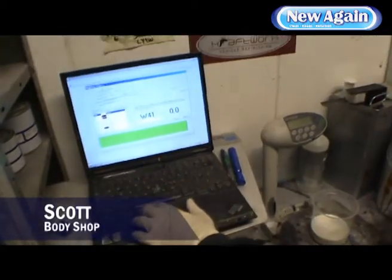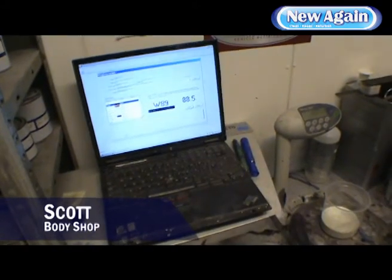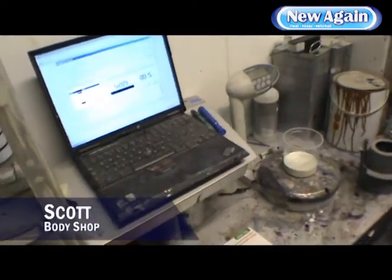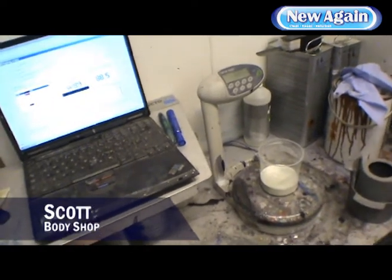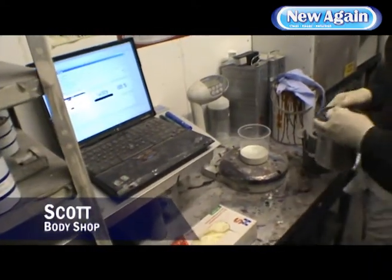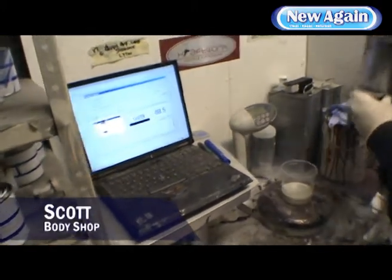The quality of materials we use is the same as the body shop, but the lacquers we use, because of the non-isocyanate formulation, are actually more expensive than the body shop. Basically, you get a blue line across here — when it's blue it means you can pour quite a bit more, you've got a fair way to go. Otherwise you could end up putting too much in, like when you're filling your car with fuel and you want exactly £20 — you have to slow down near the end. If you do go over, you can recalculate the whole mix, though it would mean mixing up quite a bit more.